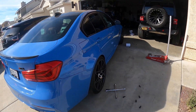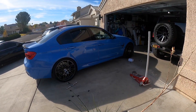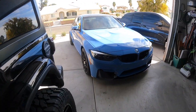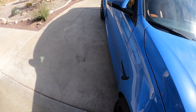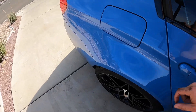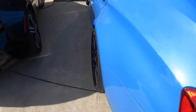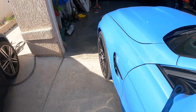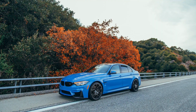Overall, pretty pleased. I'm going to get the torque wrench and torque everything down — I think it's 105 foot-pounds. Let's get this buttoned up. It is all buttoned up: 15mm in the front, 12mm in the rear. I think it's a good fit. No rubbing, and this is on the competition setup. Not bad.